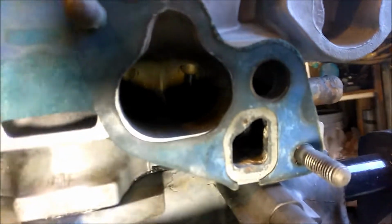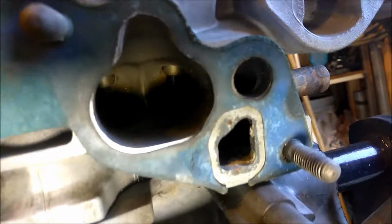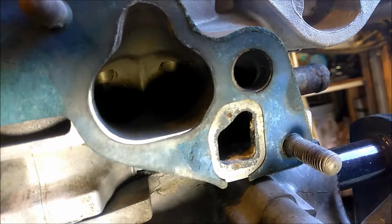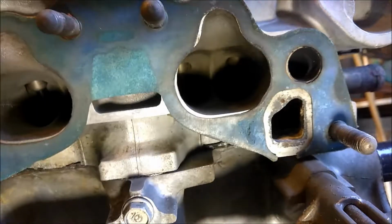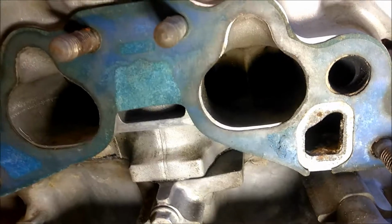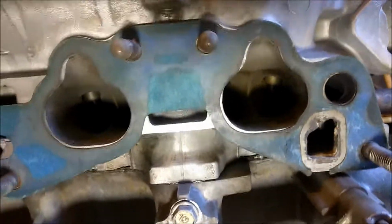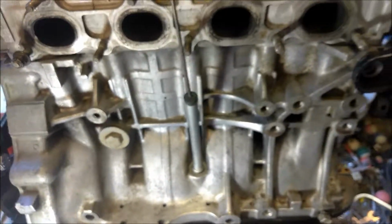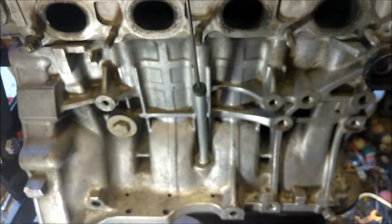So yeah, and then for the exhaust and the intake manifold, in case there's any water, you could use the vacuum. Well, I use the vacuum, but where it blows air, I tilt the engine stand a little bit lower, the engine, to one side, and then put air, and make sure that it comes out. It kind of dries it off too. And then, well, everything's good. The only thing I had to do is put the crankshaft and the bearings, and that's all. Well, that's going to be in a different video. I'm going to show you guys.